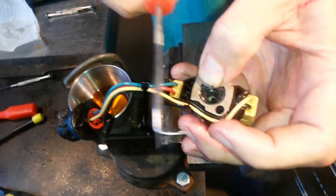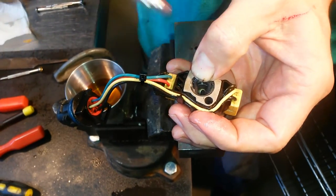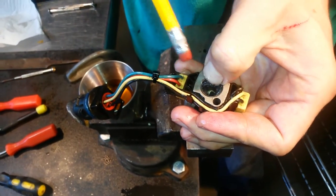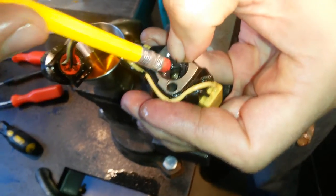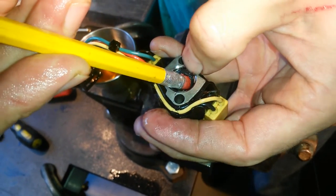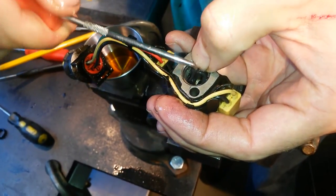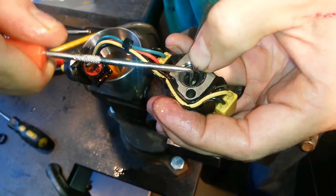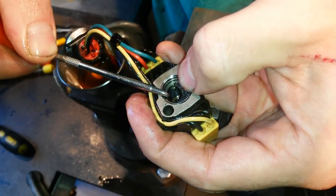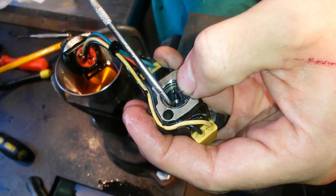That can actually do quite a bit of damage. If you've got sharp edges on your picks or your screwdriver, you want to try to file those down so you've got a nice dull edge. As I'm pushing down on the back with my thumb, I'm going to use the pencil eraser to just kind of work it down into that groove. If it falls out of your channel, you're going to need to pull it back up — you'll have a much better time if that bottom edge stays in that channel throughout the whole process.